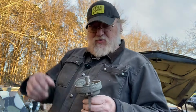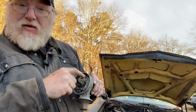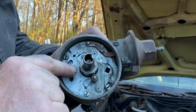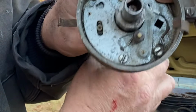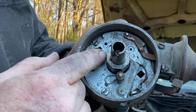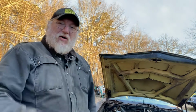So here's an old distributor I was going to take the parts out of. This plate won't work. But there's a plate down here that the points bolt or screw to. You can see there's a screw hole there, there, and there. Points and condenser. All right. You set your points gap based off these cam positions, these lobes on this cam right here as it rotates. You can see the little points. That's what you set your points gap off of. So they open and close. They close on the flats, open on the points. Well, what's happening is this plate right here, something is broken, and this plate is physically wandering out and back. So instead of the points opening and closing, the points are kind of doing this. You know, and we're not getting consistent spark.